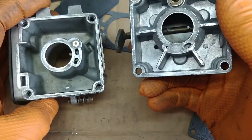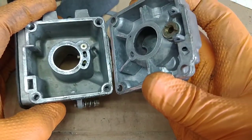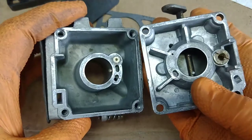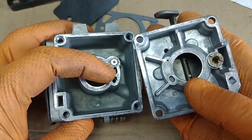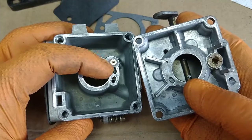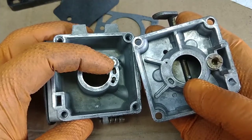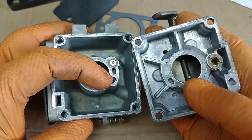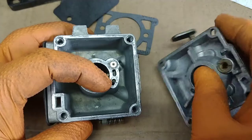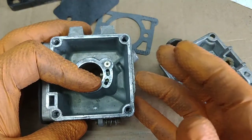As you see the two halves - when you look at them you can see that there's holes there. There's a hole there that's actually connected to this hole. That's all high-speed stuff right there, high-speed flow. And then this is your low-speed hole there. The way you can figure this out is you can actually just examine the casting.